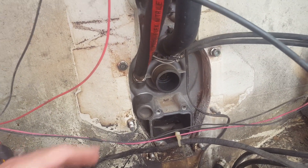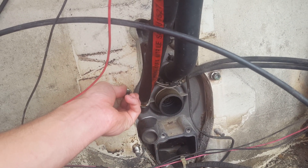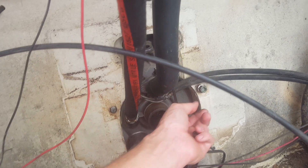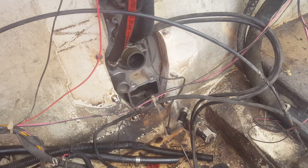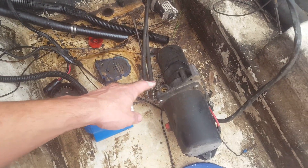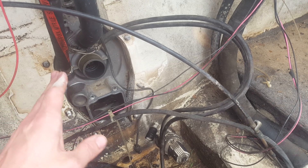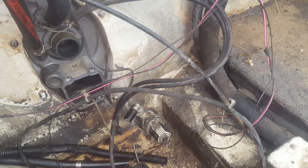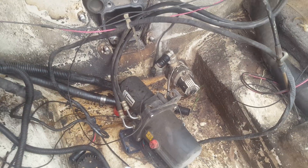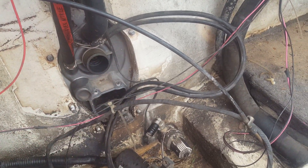I have someone on the other side holding the out drive mount. I'm going to go ahead and remove these little nuts as we are ready to pull this thing out and start working on this transom. You want to make sure you don't kink the lines to the pump — notice there is a little bit of extra hose so it can go down and drop like that. Keep that in mind as your partner helps you; pre-position it so you have enough hose to set it down on the ground.